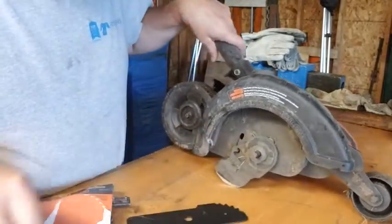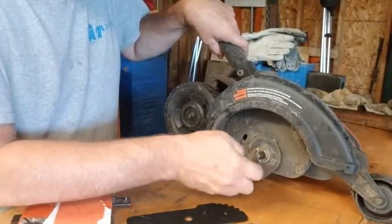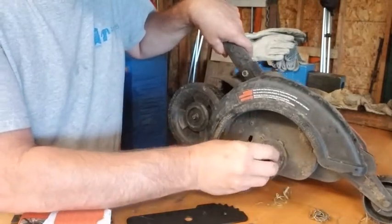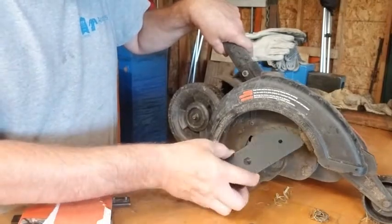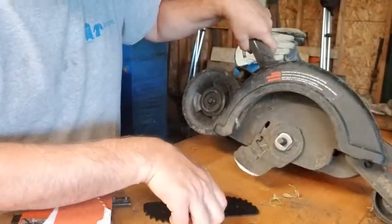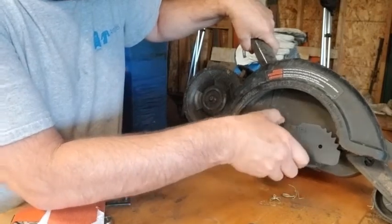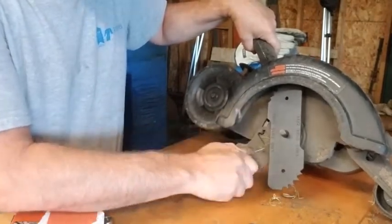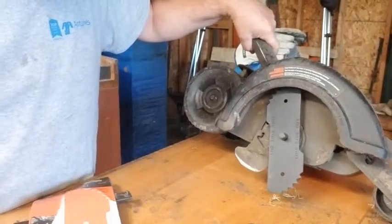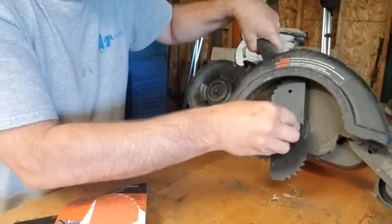All right, so they gave you new washers, these ones, so you can take these off if they're beat up. And I'm going to. Looks like I got some grass caught in the bearing bushing here. Take that off there. The blade says this side out, so we're going to put that on there. And look, we've got to get all this dirt out of here because the blade won't go around now that it's bigger. Looks like it will go around now. Looks like we've got to get this dirt off of here. Then you've got another washer you can put on. And like I said, I'll probably save the old parts because I like welding stuff, but I'm going to put the new ones on.